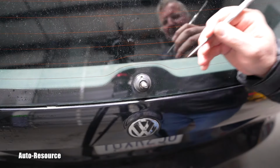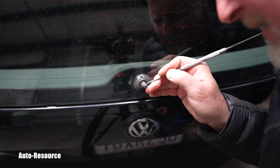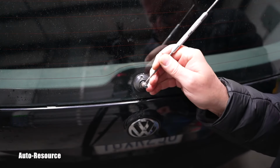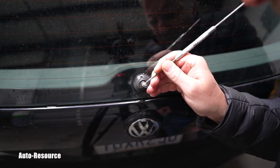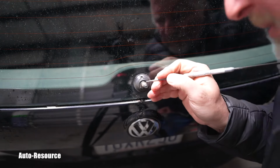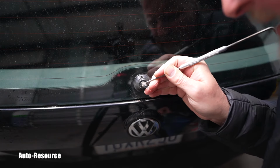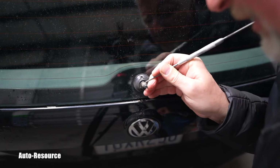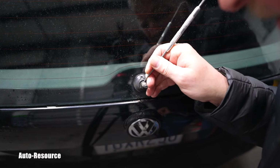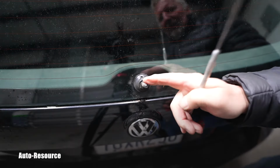And as I'm looking at the shaft, it's becoming clear that there is a lot of rust in these grooves, so I need to take time. Yep, maybe you see that buildup popping off. It's the corrosion, basically parts of that previous part, and here are the grooves where the new part will engage. I'm using this very sharp pointy tool to clean every single one of these grooves all around, so the new part will be nicely seated.